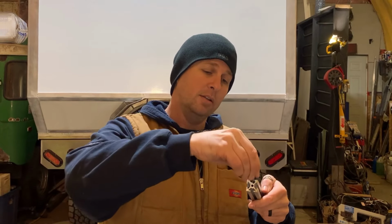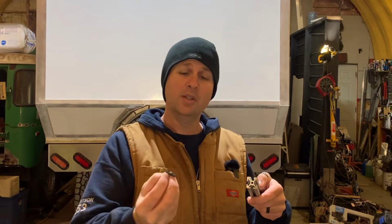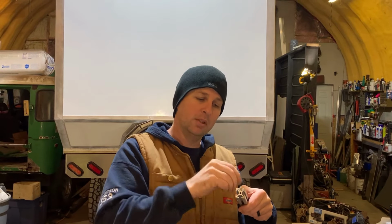Now, there are a few things that I need to consider before I go bolting this onto the roof. One, I need to be able to get nuts into the slots. Most T-slot nuts slide in from the end, though there are some that you can drop into the slot. The ones that I have are end insert. Now, because the metal of the roof wraps around the end, I don't have access to the end to slide the nuts in, which means I want to remove a section of the inboard edge so that I have a place where I can put them in the top or in the inboard face and slide them along.